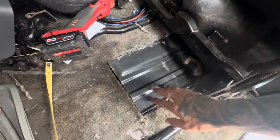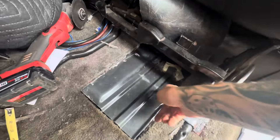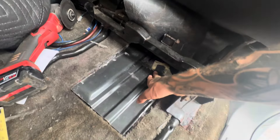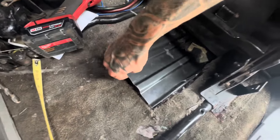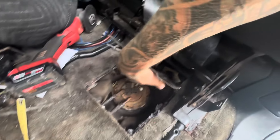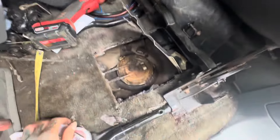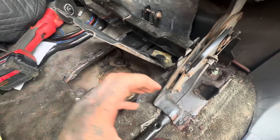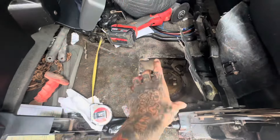When you go to peel the cut piece up it's a bit hard because the corrugated part makes it stronger to bend. I got a screwdriver in there, pried it up, got my hand in, pulled it up — and there's your fuel pump. Plenty of room to get in, disconnect your lines, spin it, and pull the fuel pump out with a slight turn.